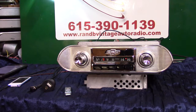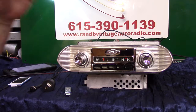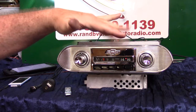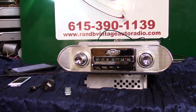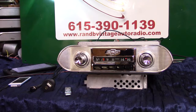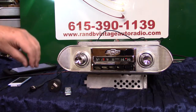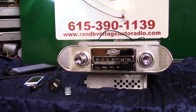It's got an original 1963 Nova original AM radio. It's got brand new chrome on it where we re-polished all the push buttons, re-chromed the outside knobs, polished the back plate on it — it is aluminum — and we've done a full Aurora design conversion. It's got AM FM stereo, auxiliary in which is automatic, four channels out, 45 watts a channel.